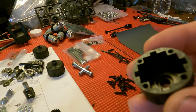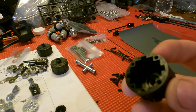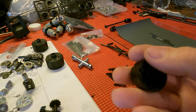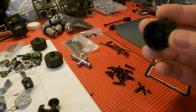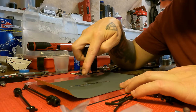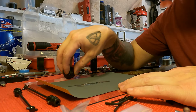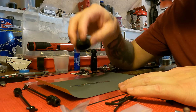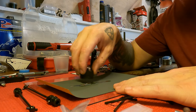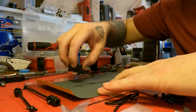Take a little bit of WD-40 — it's really just there to stop the sandpaper from getting built up with plastic. Put a little bit on there, then take the case and swirl it around. What you're trying to do is knock down those little molding marks. The glass is really just to keep the sandpaper flat — you don't want to sand on an uneven surface because it could mess up the case. You need something flat and smooth.